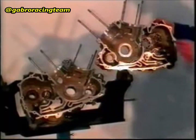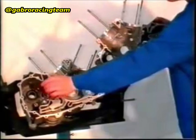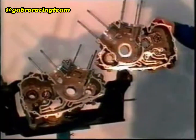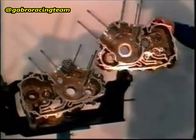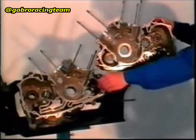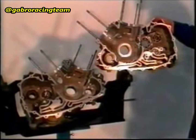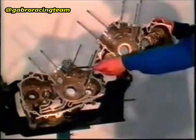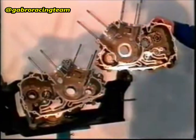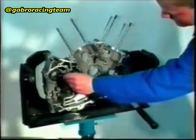Apply anti-seize Loctite to the bearing housings for the main and transmission shafts. Apply Molykote GN to the half bearing brasses of the driving shaft and of the counter shaft. Also apply Molykote GN to the oil spray tube. Grease the oil seal of the transmission shaft.